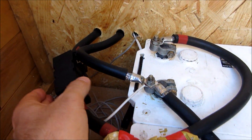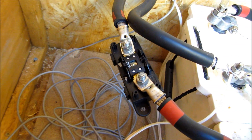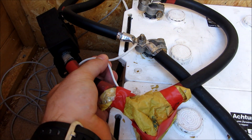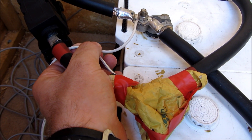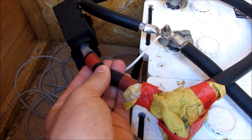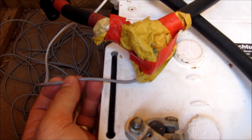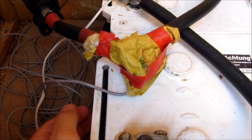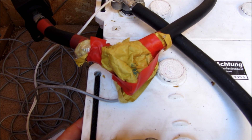Also in here we've got the fuse — inside the box there's a 250-amp fuse, which is plenty for the things we're running off the system. This white cable is the battery sense, which lets the controller indoors know the actual voltage at the battery terminals, because the voltage detected at the end of the big power cables will be different due to voltage drop. Finally, this grey lead goes to a temperature sensor bolted onto the positive terminal of the battery so the controller can adjust the charging voltages based on battery temperature.